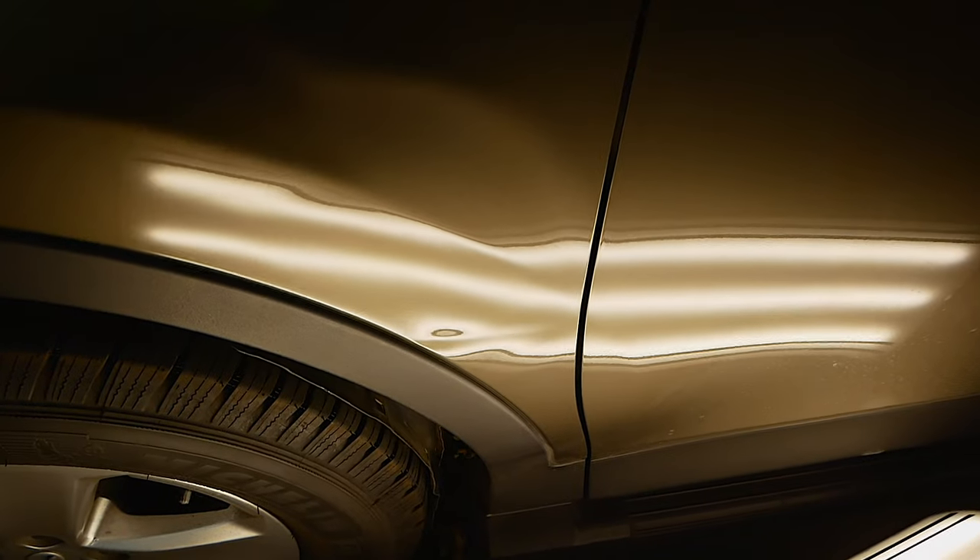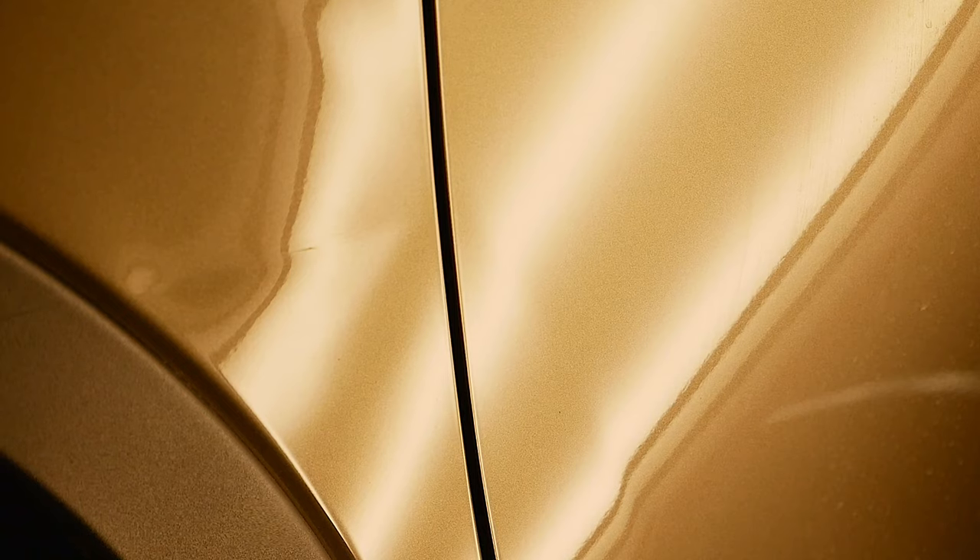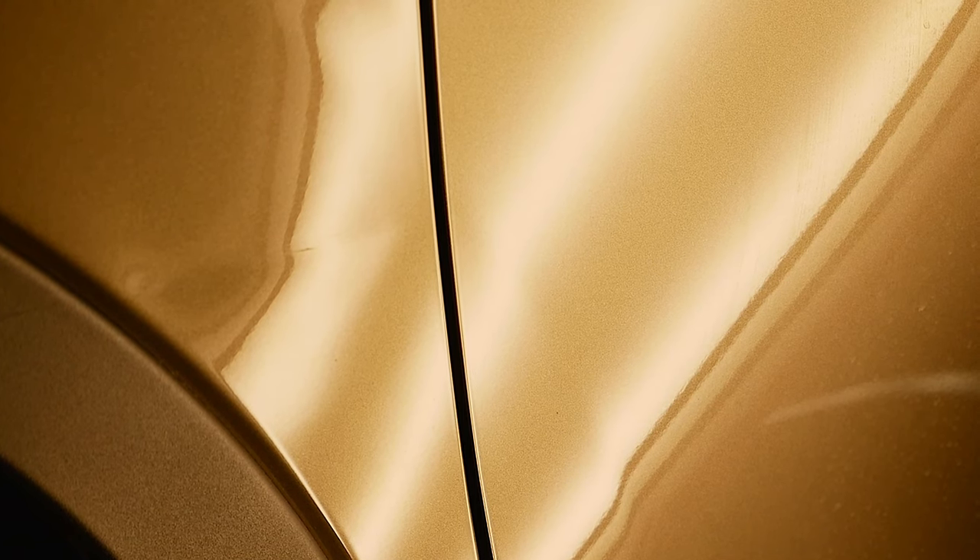Now I want to switch over and work down on this lower crease. I'm not going to completely finish this part of the repair until a little bit later, but I want to start with a soft tool — I've got another tip with just some Tessa tape on it. I'm going to use this behind there to lightly bring up the dent, working from the right side of the crease over towards the left, just lightly bringing out the deeper part. If I used a sharper tip tool, it would probably make a lot of poke marks, so I'm doing this softly.